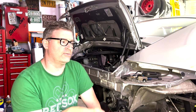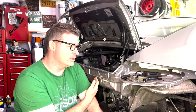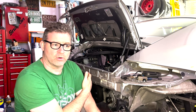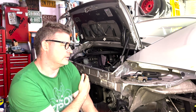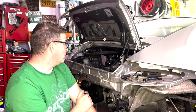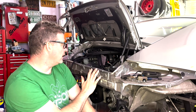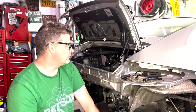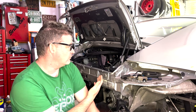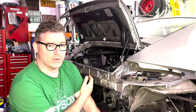I wish I had known this before I started because I would have done it to begin with. When I originally fit the motor and was trying to fit the water pump, I did have to do some extra cutting into the support bracket which I could have used for supporting my airbox. I would strongly recommend this — if not say required — just to give you that extra space because the space is pretty precious towards the back. You could also argue it allows you to get more center mass and have the engine sticking out less at the back. It's only an inch and a half, but that's where the weight is, so it gives you better center balancing.